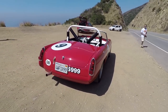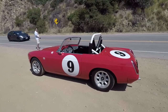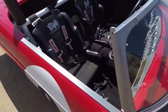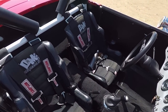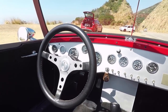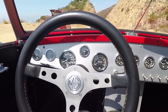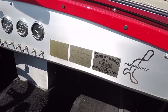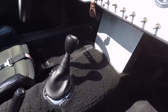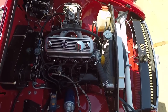It's a 1967 MGB built to period race specs — not a vintage race car, but a replica of what would have come from the factory works program, built to Stage 5 specs. Probably about 125 to 130 horsepower, with a high-duration cam, and converted to a Datsun five-speed back in the '80s. It was originally a four-speed, and now it runs a five-speed out of an '81 200SX with a Weber 45.